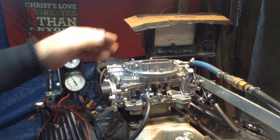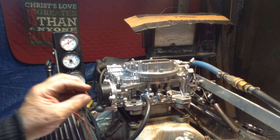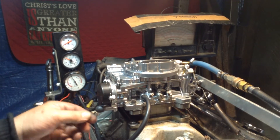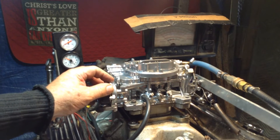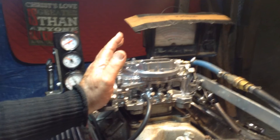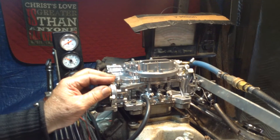Of course, they got different numbers, which would indicate the year, but they're all the same. This one has the heat choke with a heat tube, and as you know, these things never did work even when they were new, so we encourage you to let us put an electric choke on there for just the cost of the parts.